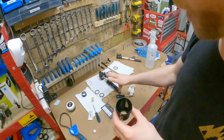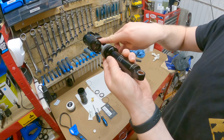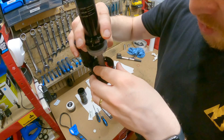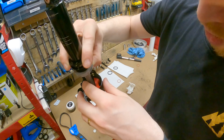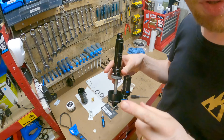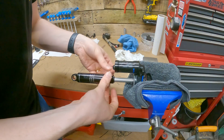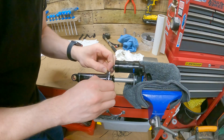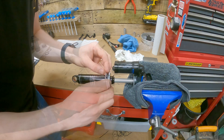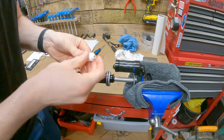That's the air can done and ready. Now let's focus on the main shock assembly. The first seal I'm going to put in is this big seal which goes up here by the volume spacer - the one I almost forgot about. I'm just going to slide that on - it's going to sit nice and in place at the top of the shock. After a bit of convincing and removing the volume spacers, that's now in. I need to put it back in the vise, then I'm going to put one of these white split rings on at the top, then the rubber seal, and then the other white split ring. Then a nice healthy dose of some dynamic seal grease.